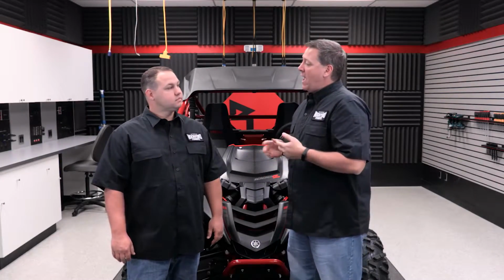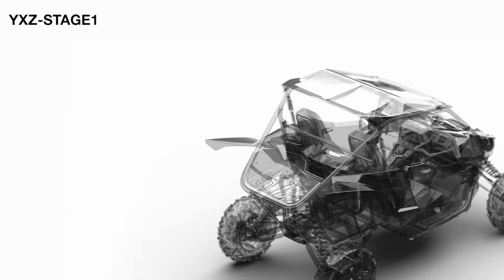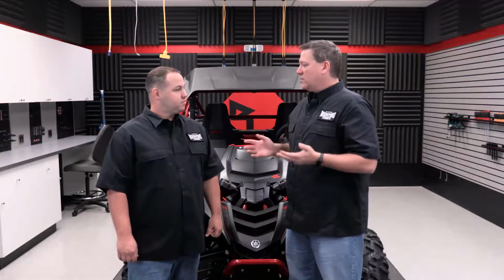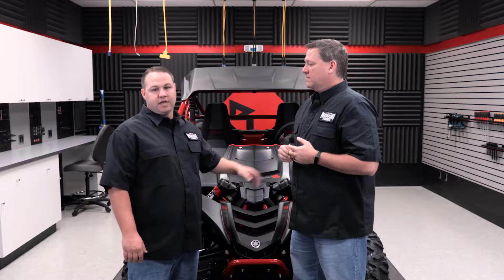I'm now joined by Brad with our new product development team, and he's going to be helping us do the installation on this YXZ vehicle. So Brad, what is it we're going to be installing today? Today we're going to be installing our YXZ side-by-side Stage 1 kit. All right, and what's all included with that kit? In the kit we're including our PMX2 source unit, the YXZ dash kit, and wiring harness. Okay, well let's go ahead and get started. What's the first thing we need to do? The first thing we need to do is remove this hood, and then that'll allow us access to the back of the pocket and the wiring we need to get to. All right, well let's get to it.